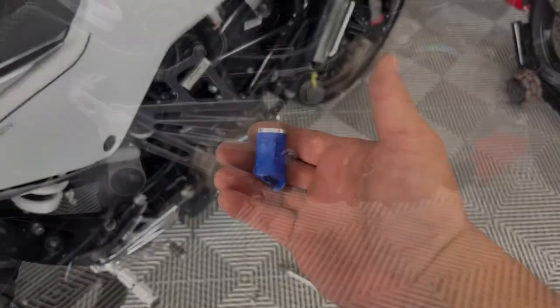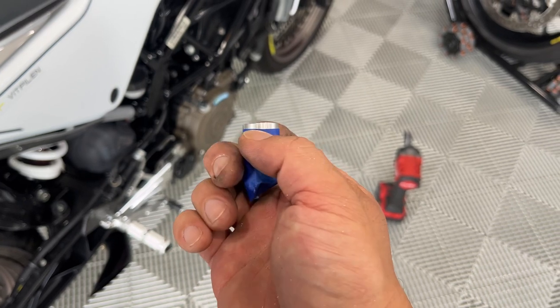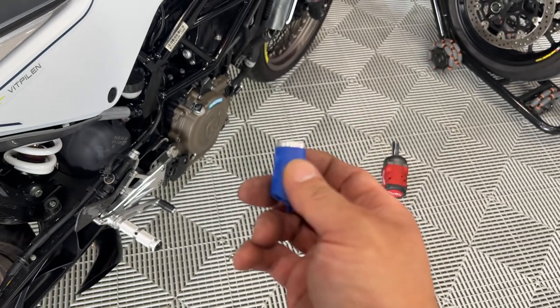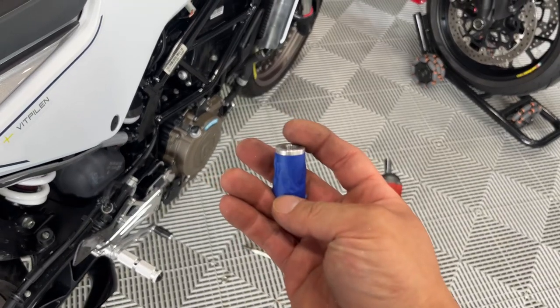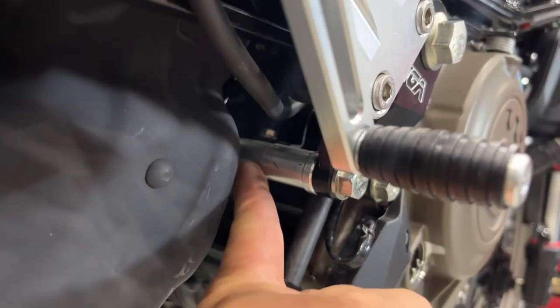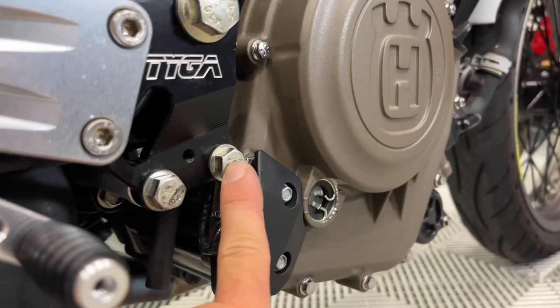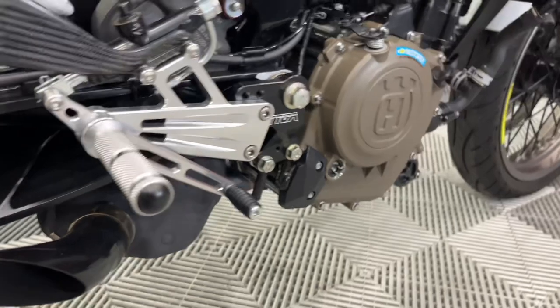The spacers intended to delete the kickstand actually worked here. I cut them down a little bit, and there's one behind this bolt and one behind the other — I cut them to the same length. They support the bracket as you torque it down. I'll use thread lock on pretty much everything — I'm using blue Loctite or Vibratite rather than red. Blue Vibratite has always worked really well for motorsport applications in my experience.